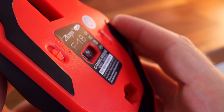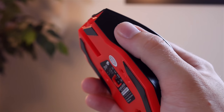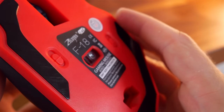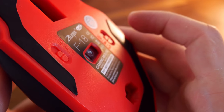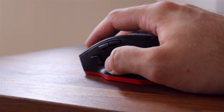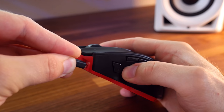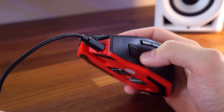Looking at the bottom of the mouse, there's three preset modes. The top one is multimedia, which basically reassigns all the buttons to control Windows Media Player — the scroll wheel becomes volume, the fire button is play/pause, etc. The next setting is gaming mode, which sets the mouse to 500Hz polling rate, and the bottom setting is work mode, which sets it to 250Hz to conserve power. Obviously the higher the poll rate, the better it's going to perform in games. You can charge the mouse with the included micro USB cable — the port is on the front left of the mouse, and you can use it while it's charging. The cable length is around 1.5m.